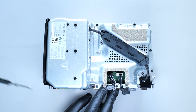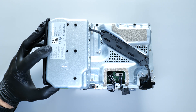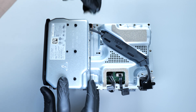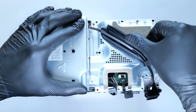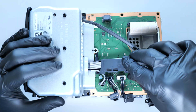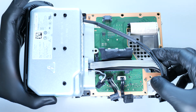And now it's time to remove all the screws. Remove this bracket and the remaining screw. Once the screws are removed, detach the power cable from the plastic holder and lift the metal cover off the board. Next disconnect these power connectors by pressing on their latches, then remove the power supply.